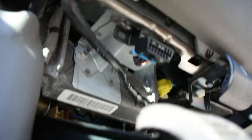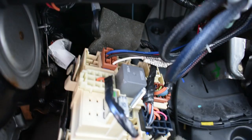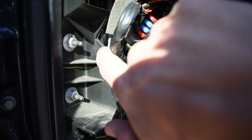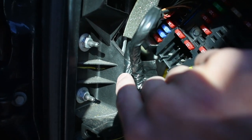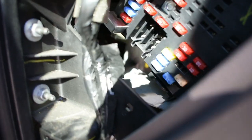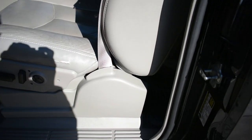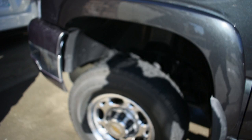So what you have to do is open up this box and find — that's what you're going to tap into for your dome light. I followed that wiring harness up here to the interior fuse panel. It's not this one that's sticking up, it's this wire here — or that group of wires — that you're going to have to open, and I'm going to be slicing mine in here. Right in there is the plate where that light will be going. I'll be installing two LEDs in each front footwell, and I'll actually be running wire to the back seat as well, which never came from the factory.